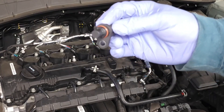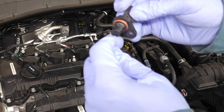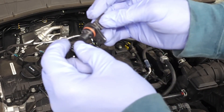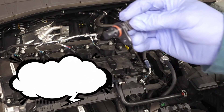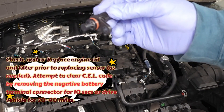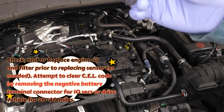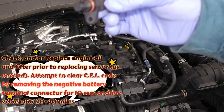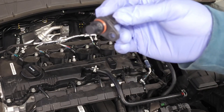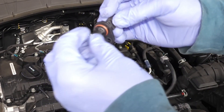What I do want to recommend is that if you take the sensor off and it's coated with oil — and the oil is reddish brown or you can clearly tell there's sludge on it — before replacing the sensor you should always replace your engine oil and oil filter, and then try to reset the check engine light before replacing the sensor. It's critical that you maintain your oil in very good condition because it will wreak havoc on these magnetic sensors.